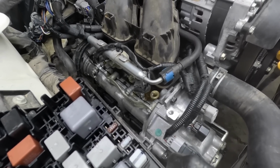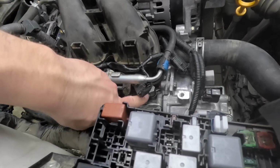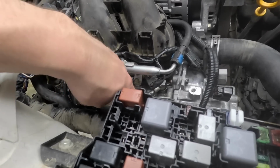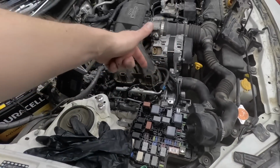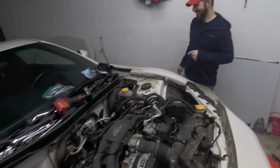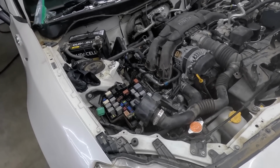Oh, there's like a tube, right? What was missing was this little external bypass that goes from the front of the head to the back of the head, which was leaking a bunch of oil out. Hopefully that's where all the oil is coming from, and hopefully that's why this phaser on this side keeps clickety clacking. We'll see. We're hoping. It went away. Still not starting though.